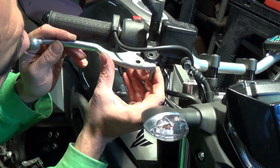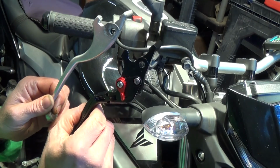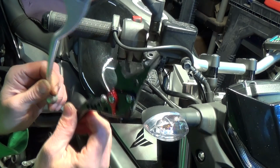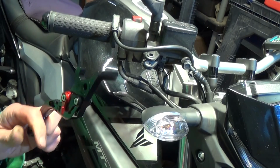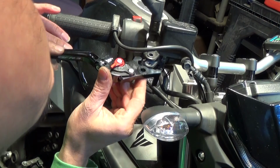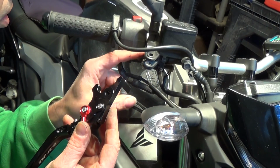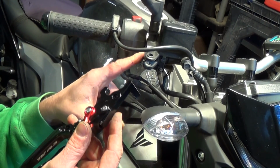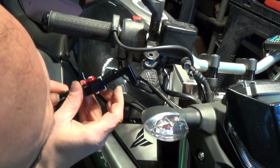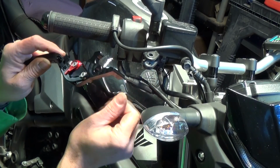There's no bushing or O-ring on this one, it's just a plain aluminium handle. Compare it to our new one that we've got. It looks pretty much the same. It's fairly straight, same thing as actually this one. So that's quite good. This should be a lot easier than the other side because you've got nothing to adjust really. So that pushes on the plunger for the brake on there. There's a little piston in there which goes onto there. This lever will activate the brake switch.